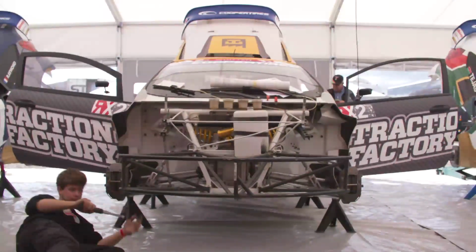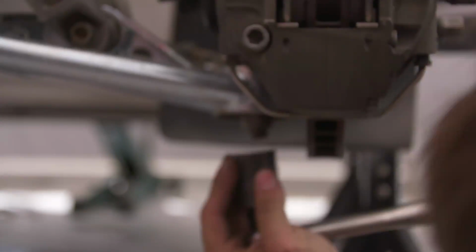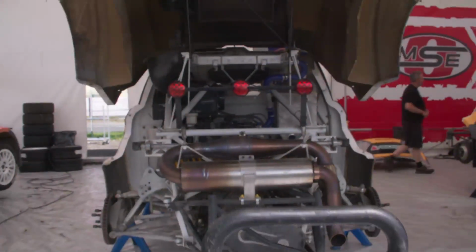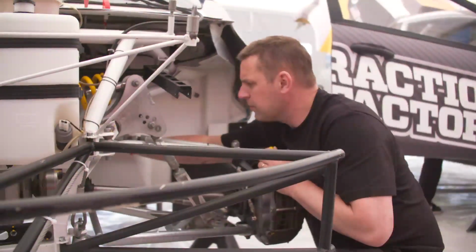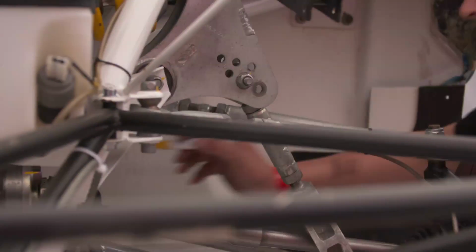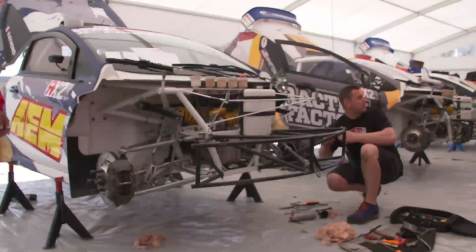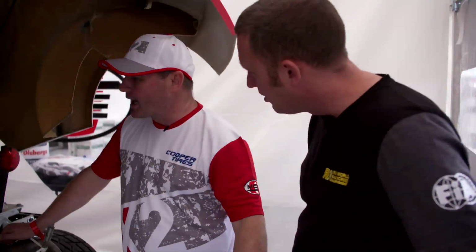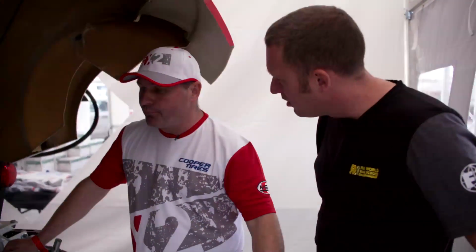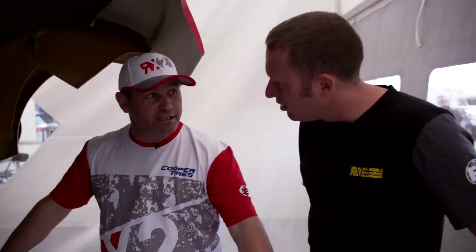Well, we've got a permanent four-wheel drive, 300 horsepower, normally aspirated engine. So the idea is to make them as similar as we can to the supercars that are out there. We have a SADEV four-wheel drive system, which actually copes with a lot more horsepower. So we're after reliability and cost, but equally keeping a product that's pretty similar to drive as they go up the championship order. We'll head around the front, just going to look at the front end of the car.